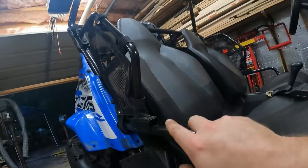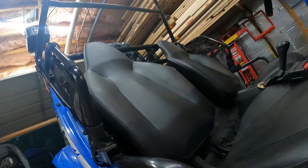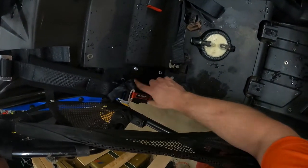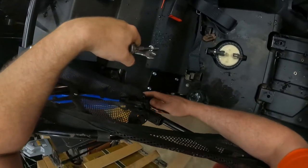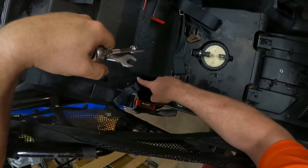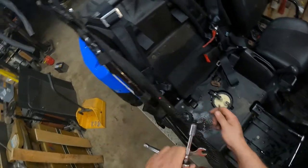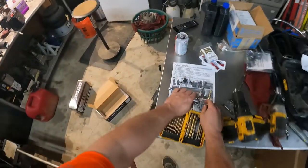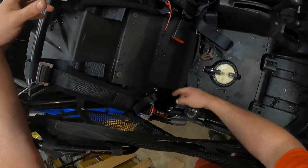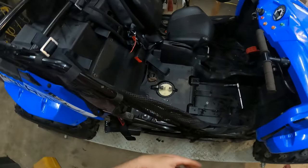These seat belt covers — this one's upside down but it's fine — are supposed to go here to cover up this hole. I went ahead and installed that block-off plate. I used a quarter-inch drill bit, lined it where I wanted it, held it with my hand, and ran the quarter-inch drill bit through the pre-drilled hole in the plastic piece, punching holes in the back plate. Then I used a 3/8ths socket on this side and a 7/16ths wrench on the other side, tightened them up on both sides. Pretty easy, pretty quick. Gives it a clean-ish look, and your tires may not kick up as much mud into the cab — that was really the reason I installed it.